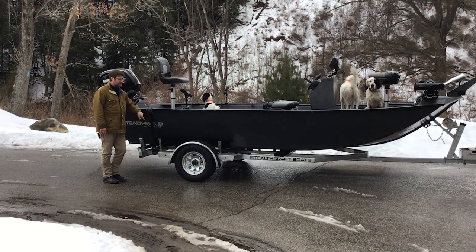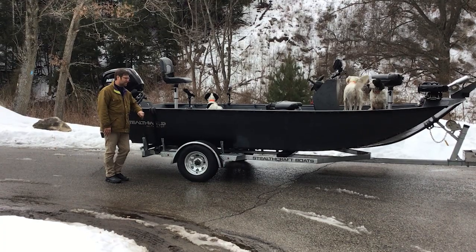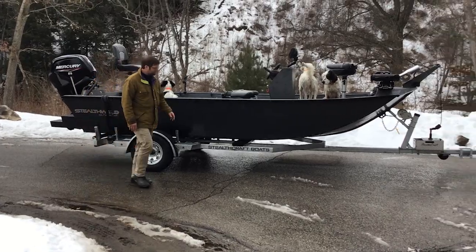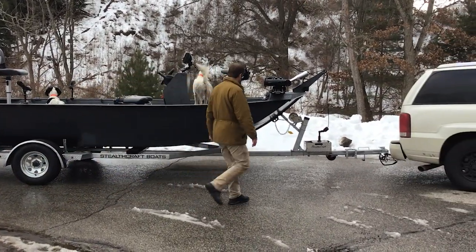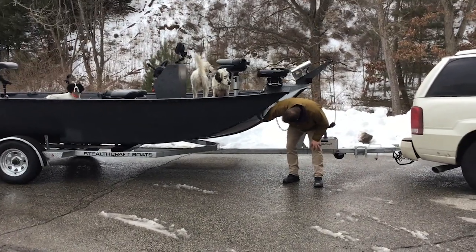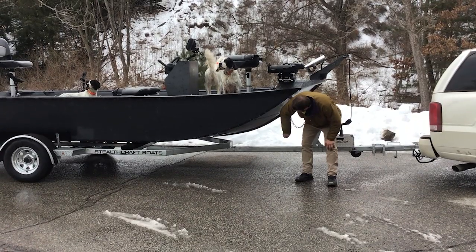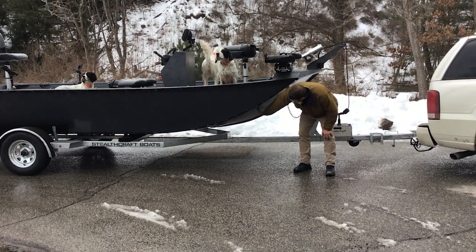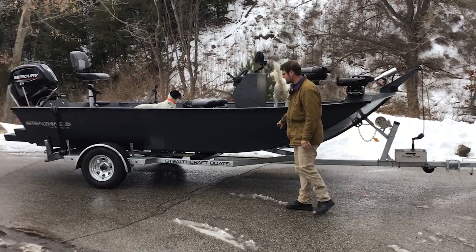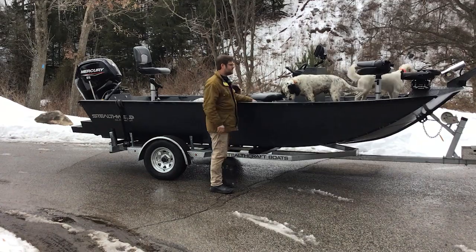It's got eighth-inch sides and 3/16ths bottom. If you're looking at other people's boats, definitely check the bottom thickness if it really matters. This has a very cool bottom — 3/16ths aluminum and then a vacuum bag plastic, like a snowboard on the bottom. This is the vacuum bag UHMW bottom, not truck bed liner. The outside and inside have our cool patent-pending spider webbing on it.